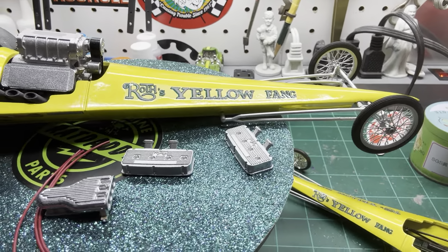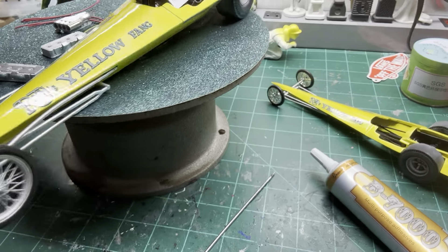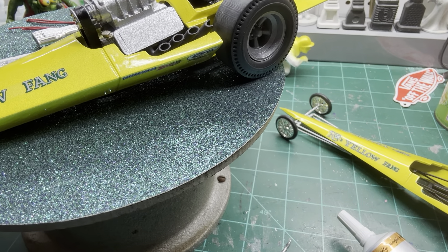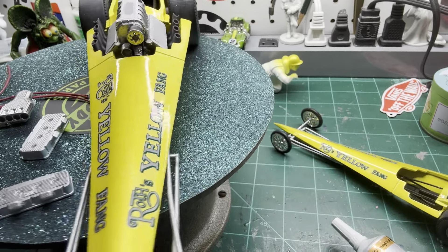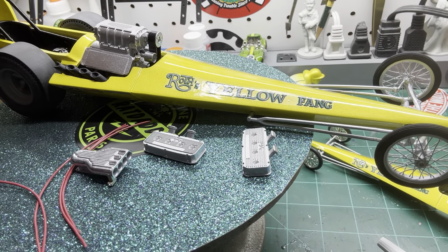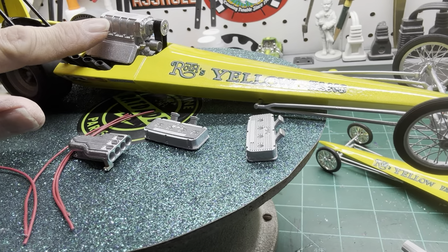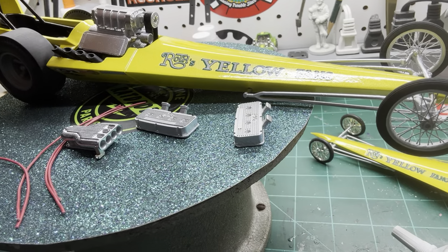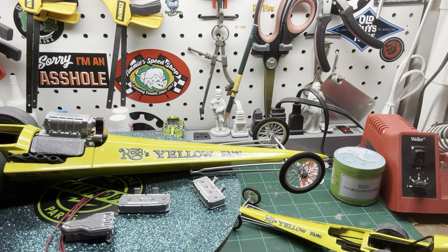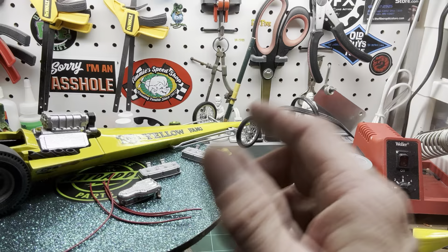There's no picture where this car looks the same. I know Chuck has been talking to George the Bushmaster Schreiber, and I think these guys were just piecemealing everything they could beg, borrow, and steal to keep this car going — every picture the motor looks different, the headers are a different color, the butterflies and injector hat are different colors. At one time there was a really tall fuel injection hat, then the blower hat was flat down on the blower. There was a chrome blower and a non-chrome blower. I went with the version that had a non-chrome blower but chrome blower hat, chrome valve covers, and black headers.